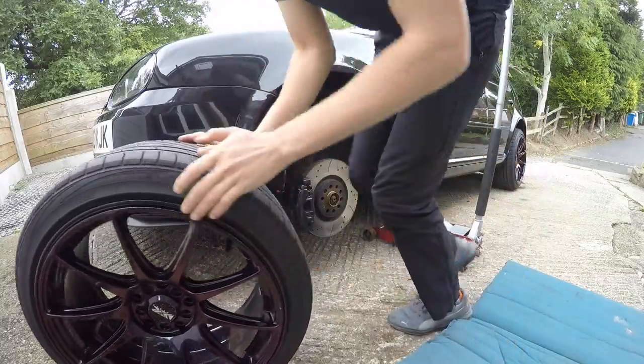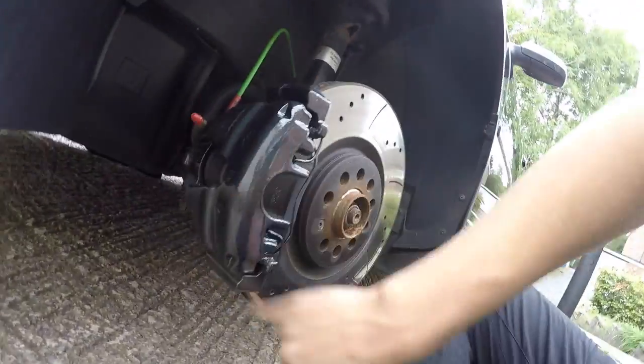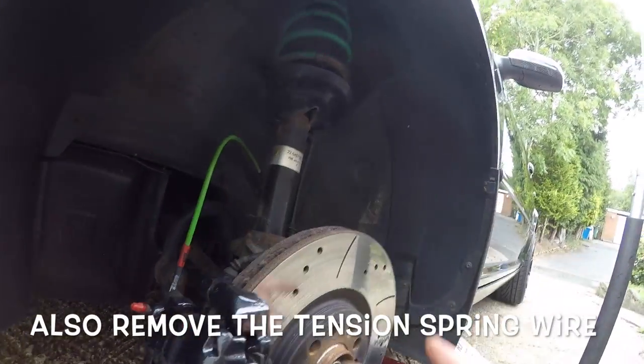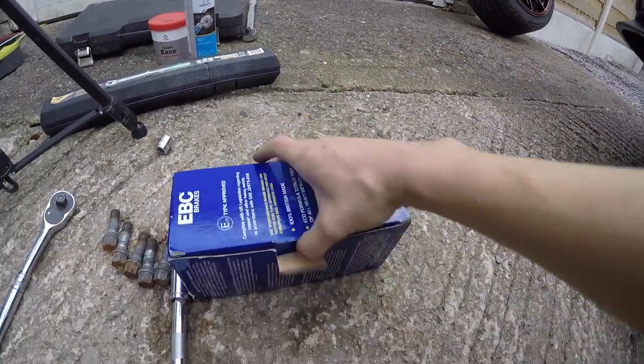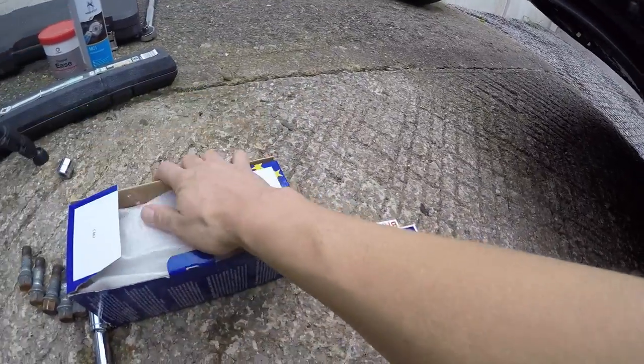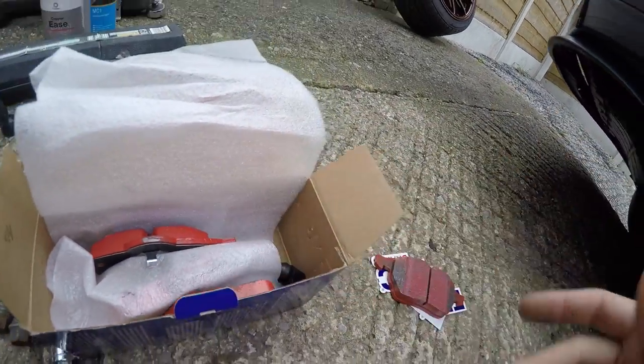You can see this one still has some meat on it, but the inside — I'll show them once I've taken them off. These look nice after Andy's lovely paint job. These are pretty simple — loosen that, loosen the other one down there, and that's it: caliper off, change them over, bang that back in, put the wheel back on. Now this side does have the sensor, so hopefully our pads have the sensor accommodation in there. EBC should have that sorted. There's no left and right — there's the actual sensor, which is only on one side.